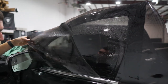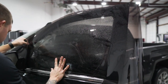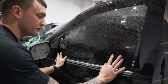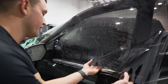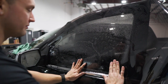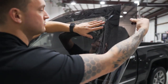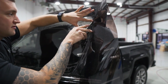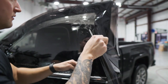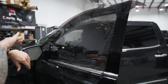Now that we have the front and the bottom edge cut straight, we'll release that squeegee mark and shift it forward a quarter of an inch. Since we have that lower gasket out, I'll go ahead and overhang the bottom slightly. So we have excess material on the bottom edge and the front edge. We'll go ahead and cut the back edge — cutting top to bottom with the knife at a 45-degree angle. Pull off that excess material, then roll it down and cut the top edge.